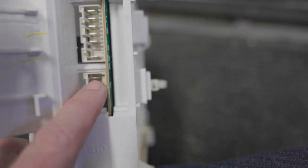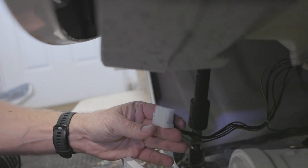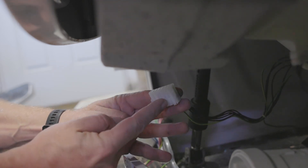The green one actually went into the top bit — remember the placement, it's on the top. There's a depress right there. If you have a little flat-head screwdriver, work that in and it comes right out. But this whole unit is in those slots and it's held in with this clip here — that one was pretty easy. Once you pull that up, you pull the whole unit out towards you and it just pops up. There are actually two clips on the same side that you need to release to get out the wire harness.